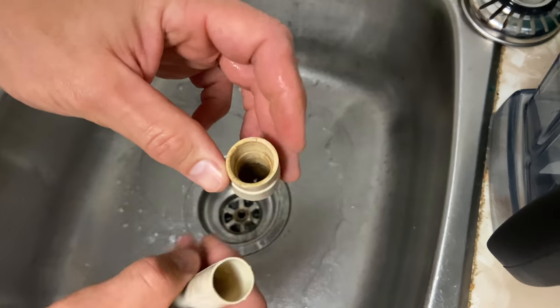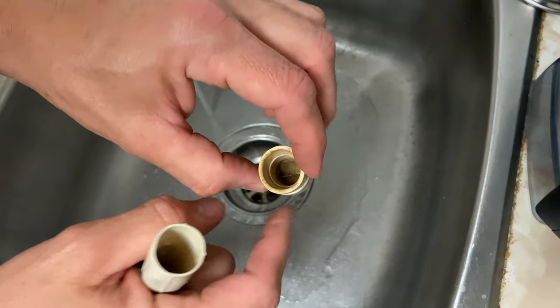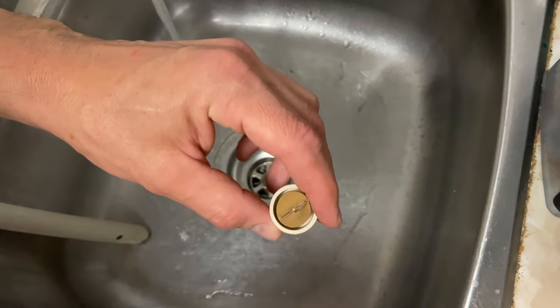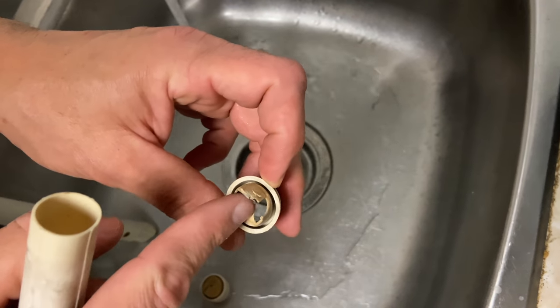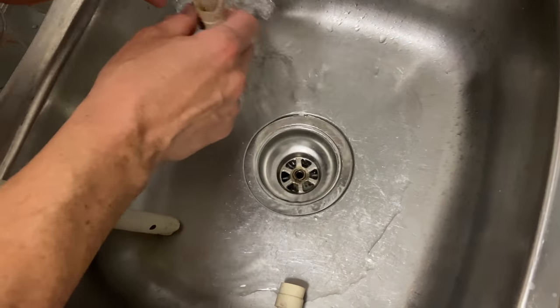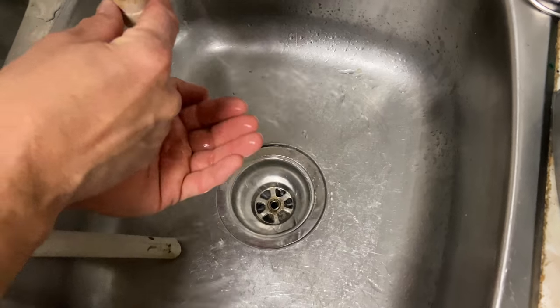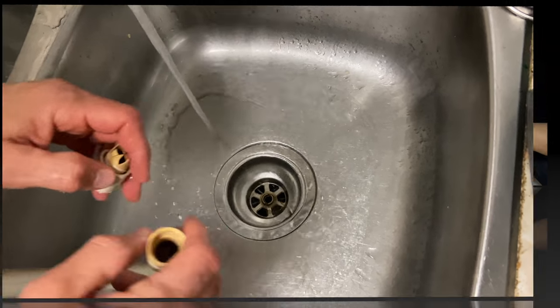Over by the sink, you can see the top part of this comes off. What actually ends up happening is these two tiny little holes get built up with debris, so you want to make sure they're clean — you can even use a knife to clean them out. Even if they're a little broken, that's okay — it just means the water will actually flow a little better. Rinse them out, make sure they drain, then clean them both and put them back in place. After you've put the drains back, just replace the cleaned cover back on the fridge.